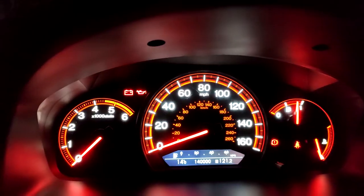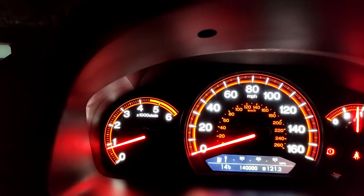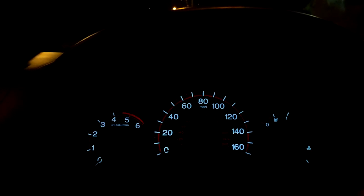So we took the car up for a quick test drive. There's no hesitation when starting, which was fantastic. We've cleaned the MAF and the MAP, took it out for a quick test drive — no error codes, no nothing like that. The car does seem to pull a little bit better, especially between 1,000 RPM and 2,000 RPM. It feels smoother to accelerate and doesn't feel that sluggish, slow, lethargic way. Normally the car felt like over 2,000 RPM it'd fly, but between 1,000 and 2,000 it felt quite slow and sluggish — this has sorted that. I just cleaned both, because once you've got the engine cover off you might as well do both anyway.